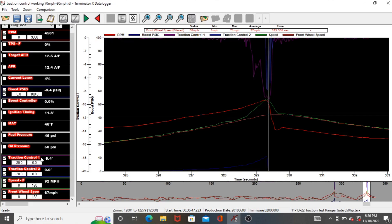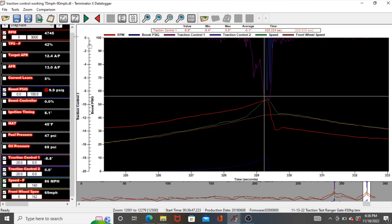I lifted before fully transferring into that second table. Overall this does seem like it's working. If this was in a track setting with a better tire and just a little bit of wheel spin — maybe 5 to 10 mph — it would pull enough timing to hook it back up with a decent tire. This truck I think is just not going to work on the street, especially with these tires. If you look at this log: it's 4700 RPM, 42% throttle, 10 pounds of boost, only 8 degrees of ignition, 70 mph front wheel speed — truck is moving 70 mph — and at about 40% throttle it's already starting to blow the tires off.